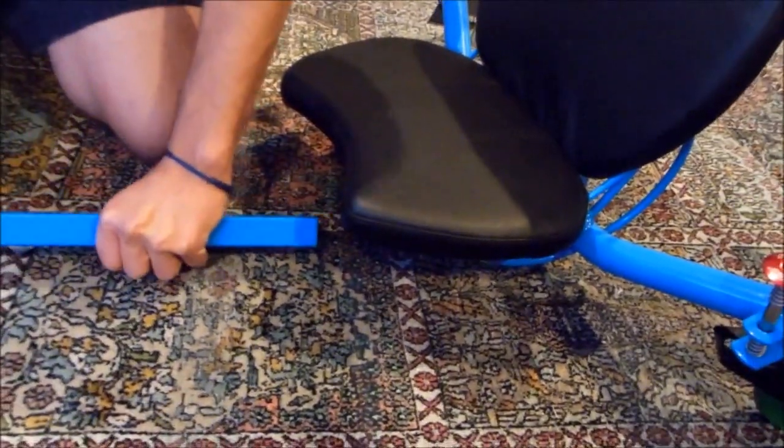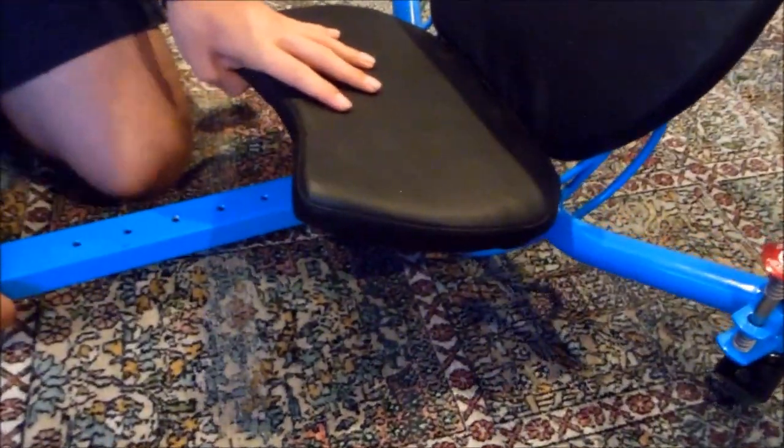you lift up your seat, and you're going to slide the square section onto the main frame. And just pull it together, jiggle it around, should slide right on. Now you come to the back, you notice that there's another hole in the top here. That's a guide hole. What you want to do is bring that back over the top of the hole behind it, and that lines up the tube with the screw. So once you have that lined up, you just tighten it down, and you shouldn't feel anything because it should be going into the hole. And once you tighten that down all the way, it should secure the main frame.